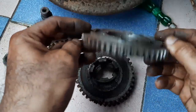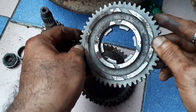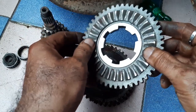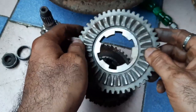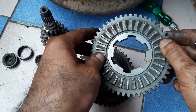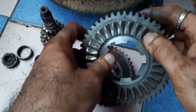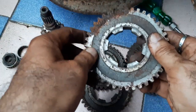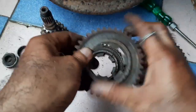After opening the gears, watch carefully for any pitting. Soak them in kerosene or wipe with WD-40. There should not be any pitting and there should not be any damage on the teeth — especially on the first gear. If there is any damage on the first gear, the kick rod will slip. These are from a scrapped engine, shown here for information.